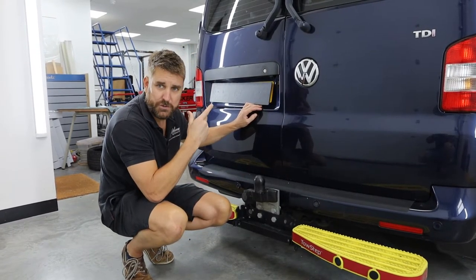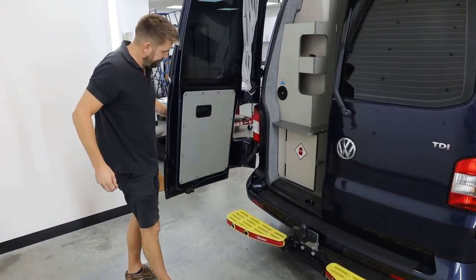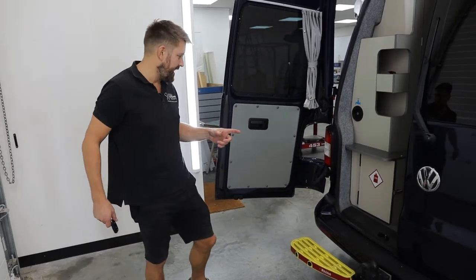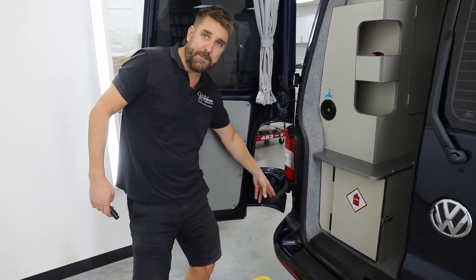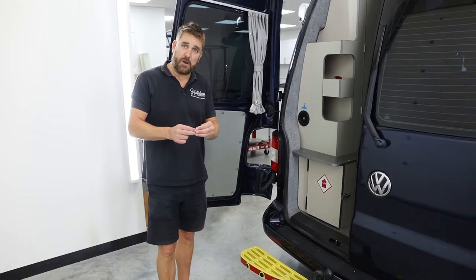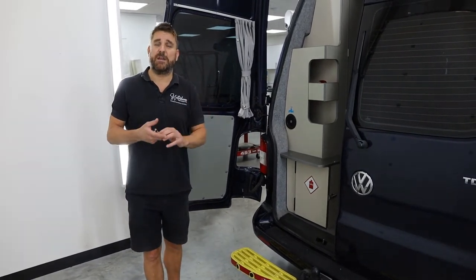Matt will show you a close-up of this camera because it really does look in keeping with the van. It's quite a fiddly job to do — that's the reason people come to us, because this is what we do all day every day. Once we've taken everything off and brought the cabling in, it has to come through the grommet, then in through the light unit. Then we go down with a good old-fashioned metal coat hanger, underneath the van, and put split copex — plastic tubing — to protect it. It's been run all the way to the front. It's a dirty, time-consuming job, but it's done, it's safe, and it's never going to be a problem.